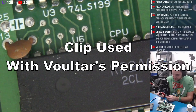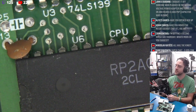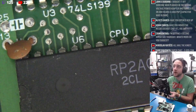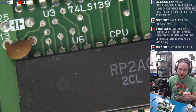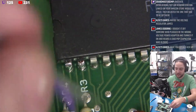I got curious and asked Voltar why he doesn't use the additional voltage regulator in his installs. He said that several years ago he did a pretty thorough analysis on the thermal dissipation and the power draw requirements of the NES RGB, even stress testing things such as power packs and EverDrives. What they found was that the current draw wasn't too incredibly extreme, and as far as the power-to-heat dissipation of the stock 7805 goes — from a performance and heat output perspective — it really wasn't necessary to include that secondary 7805.